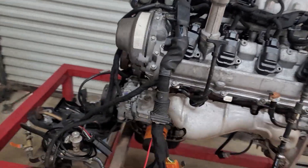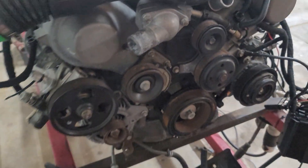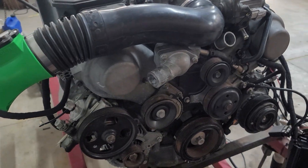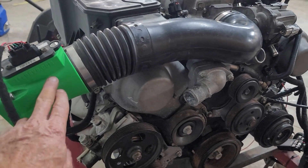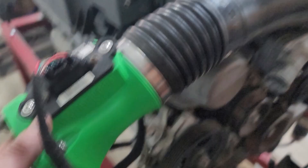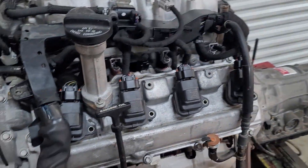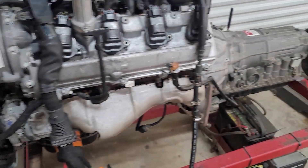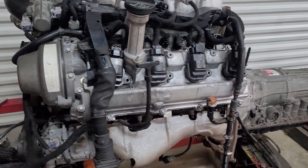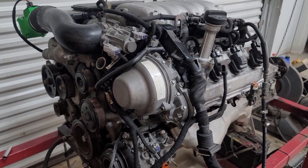She runs great — no missing, nothing like that. OBD2 diagnostics is working. Let me know about your air intake tube; it's very important to get that right because the inside diameter is something a lot of people get wrong. It's calibrated according to the CFM speed through that particular diameter, so it's very important that it's drawn out properly. If you've got any questions, let me know — it should be smooth sailing for you.